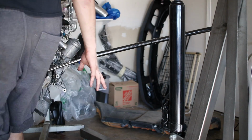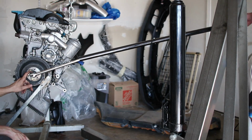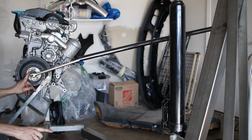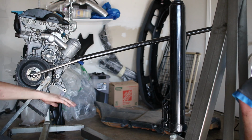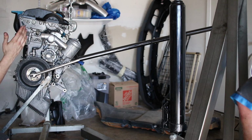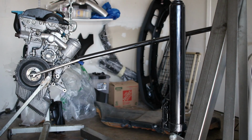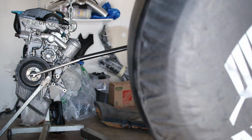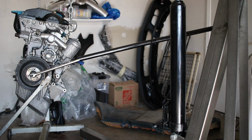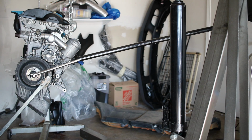So here is our contraption for putting 300 foot-pounds on this Jesus bolt. We have a 52-inch bar that is not quite level, but we're assuming it'll get to horizontal, and if it passes it, we can move it back up and try again. Then we have a 70 pound tire, sorry, which is going to go on the end of the bar as our counterweight, and I'm going to sit here and hold this end. Let's see if it works.